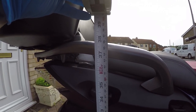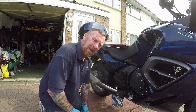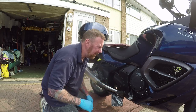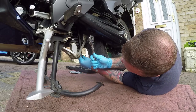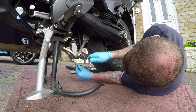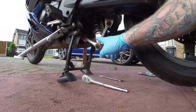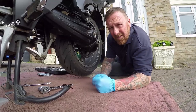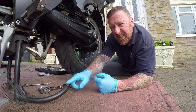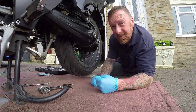We'll call that 38 inches here. And I'll show you the process. If you haven't got a center stand, you're going to have to jack the back up because the wheel will drop when you undo the bolts — the back wheel will drop. Just make sure you've got something underneath that. You need a 17mm and a 16mm on the other side — really simple tools. Remember, chock the back wheel. When you take these two off, it's going to drop.